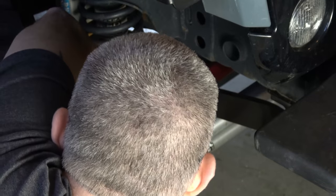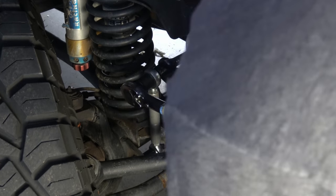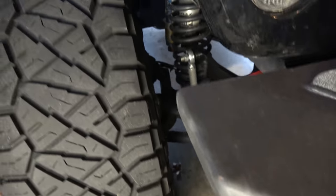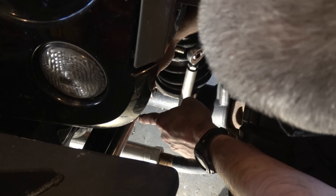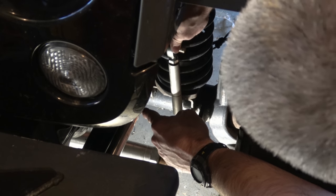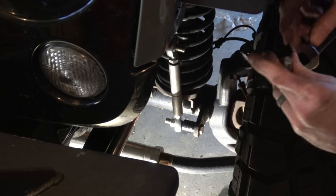For these links, they're going to get torqued down to 90 foot pounds — that's a lot, but these are half-inch bolts. And of course the beauty of this is you never have to take them apart again. That's what it looks like on the passenger side, all ready to go. You can see I have that arm pretty close to being level, which is what I was shooting for. But now what I'm going to do is go over and adjust so that on the latching side, whenever I put the link on the stud there on the arm, the latching mechanism engages easy. What you don't want is any forced torsion on that.